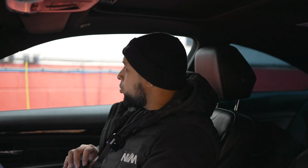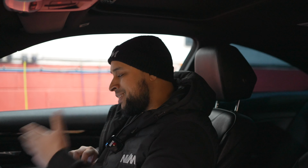So a few calibrations in and we're at 368 brake horsepower, 700 newton meters of torque. This turbo is beautiful. It's responding exactly how we want, hitting boost target. And we've actually raised the rail pressure slightly as well to equate for it. Injection quantity is nice as well.